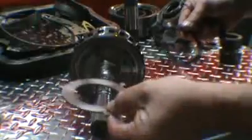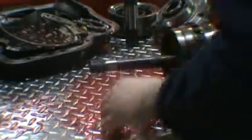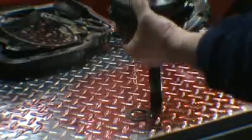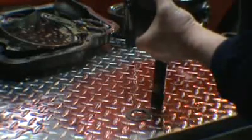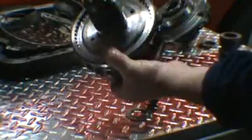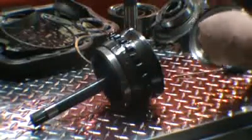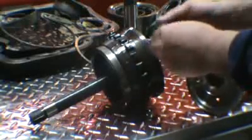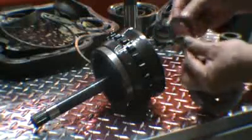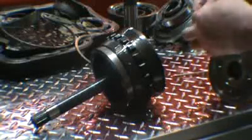Continuing on, there's two washers at the back. The 310 washer sits down in the case; this washer locks onto the gear set. There's part of the other Torrington bearing. We'll go ahead and take the snap ring out. Then the output shaft. That's the last Torrington bearing here, which goes on the output shaft — so that's number three.